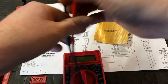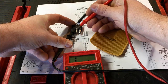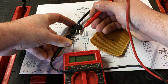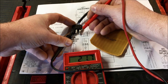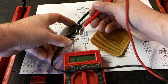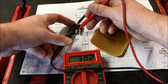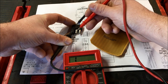We have the new heating element, so we stick it in to ground and look at the meter — this leg reads a resistance of 13 ohms, a little more than 13. Then on the second leg it should have at least 21 ohms of resistance, and it does. Going back to part one, we knew that the open-circuit leg was responsible for heat on high, so with that open circuit back to ground, that's why it doesn't work.